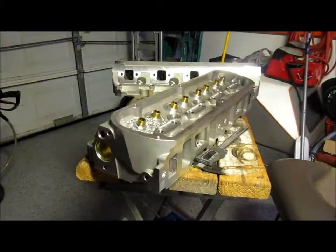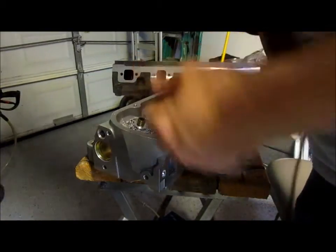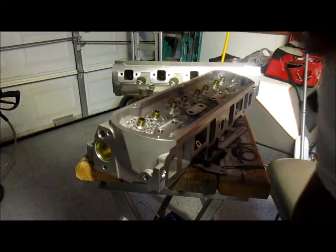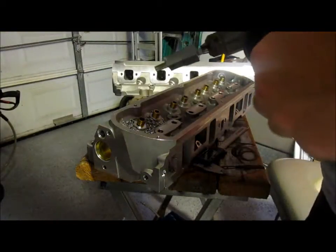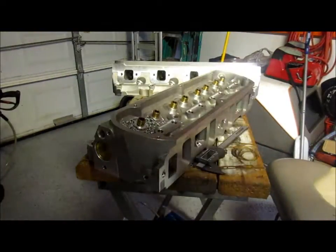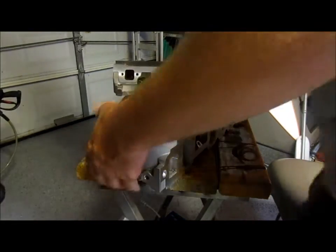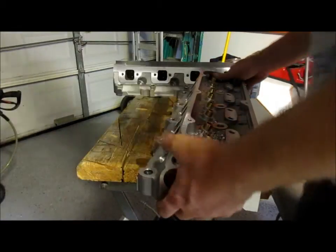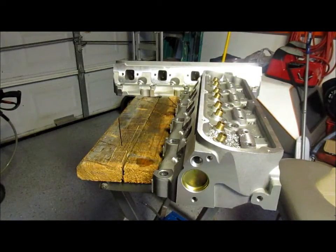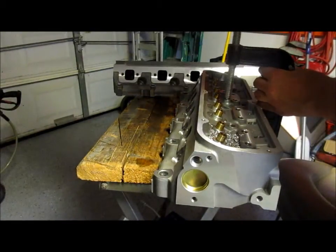Okay, it's working pretty good. It's leaving the shavings out, which I figured as much, but I'm using the Milwaukee drill motor, and I almost need to get this thing secured. It doesn't want to walk around or anything. I'm hearing some chafing as I'm cutting, and having worked with mills before, it's better to have little to no vibration when you're cutting. So I think this will work.